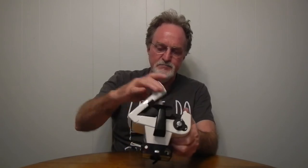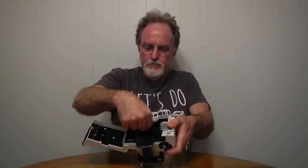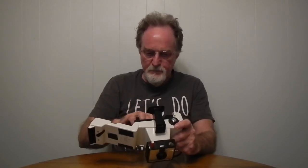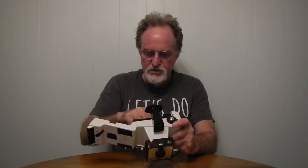It's an Everset-kind of shutter — it'll just keep firing. It has a flash bulb socket built in, and this plastic here is the diffuser. It uses the little peanut AG1 bulbs. There's a little push-in and pull-out thing in the bottom for two AA batteries. That powers the flash contact and the light for the meter. This camera will work just fine without batteries — you just won't get any metering, because you're manually controlling the aperture and the shutter is fixed.